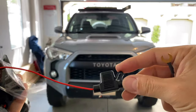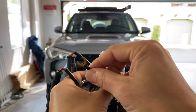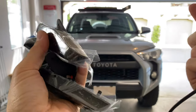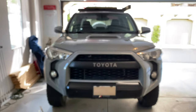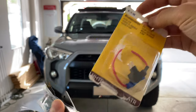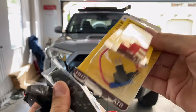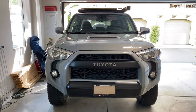They have a fuse here but it goes straight to the battery — the problem is you can't plug this into the fuse outlet, and if you plug it straight into the battery, this light is going to be on forever until the battery runs out. So I don't know why they include this. I had to cut it and buy a separate fuse tab adapter. The fuse slots were empty so I had to put in 10 amps — I bought that at AutoZone. The whole idea is that when the car is on, the amber lights come on.